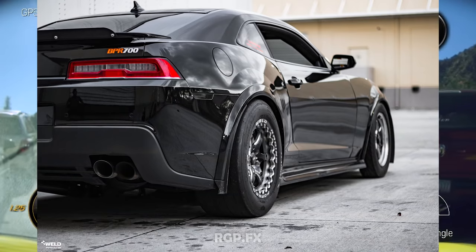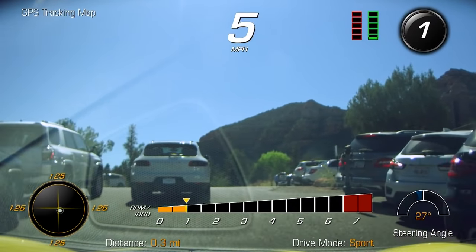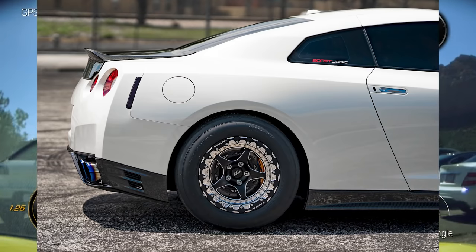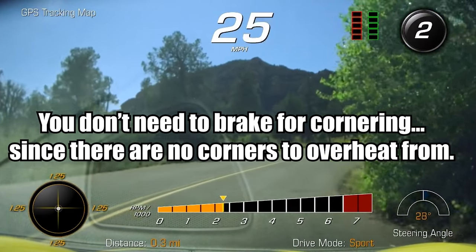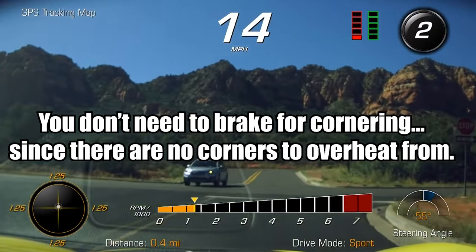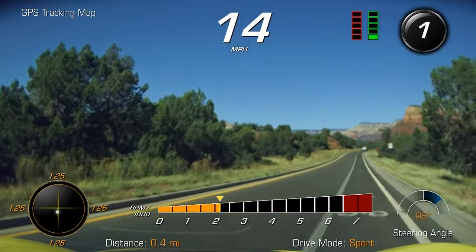Even 500 to 700 horsepower cars can gain a lot by just being on drag radials when it comes to launching from a dig. The actual reason the rear wheels are small is because your rear brakes are a lot smaller than your front brakes. When building a drag car, you don't really need big brake kits — they usually have a parachute. Your front brakes do most of the braking, so you can afford to downsize the rear wheel and fit a larger sidewall drag radial.